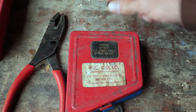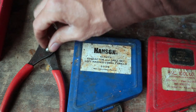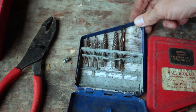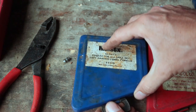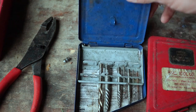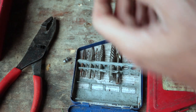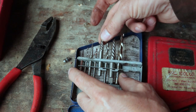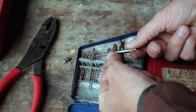So with the grease fitting broken off flush, how are we possibly going to get that out? We can't get a pair of pliers or vice grips on it. Well, that's pretty simple — the tool guys have got us covered. This is called an extractor kit. There's no need to go out and buy a Snap-on, because in my experience the Hanson brand ones appear to be the same thing Snap-on brands as their own, and they're a lot less money.